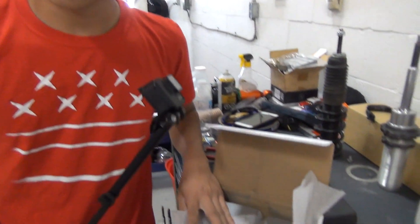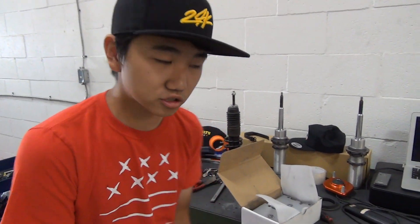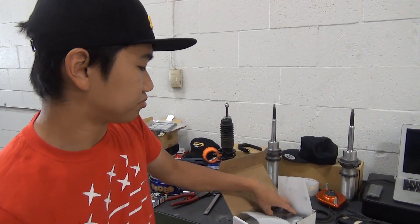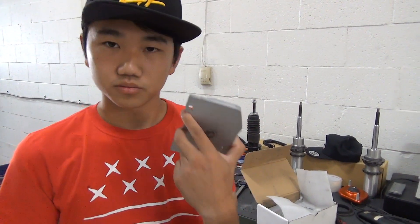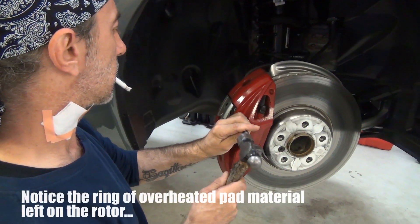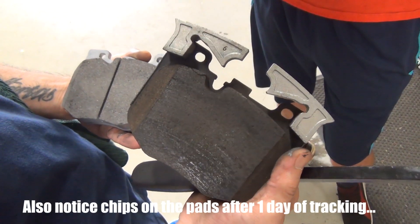Big thanks to the guys at CSG — Counter Space Garage — for providing us with these really nice track and street hybrid pads we'll be using for the Supra. They fit the OEM calipers, direct bolt-on, and this is the same compound they use for Porsche GT3s on track with Cup 2 tires. Something like this should be perfect for what we're doing — 220 wheel horsepower on street tires. There was no air gap left on the OE pad; the brakes were driven too hard. Cars are fast, so you've got to lean on the brakes.